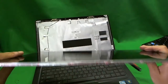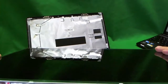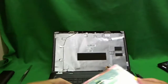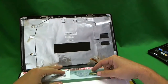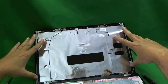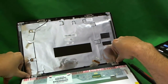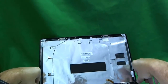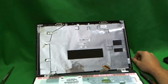The other thing to note is it has a glossy finish — most 15.6 inch LED screens have a glossy finish. Once you get your new screen, connect the connector again, put the screen back in, put the screws on the side, make sure you don't forget to tighten the screws on the bottom, put the screws on top, put the bezel back on, put the bezel screws in, and you should be good to go.